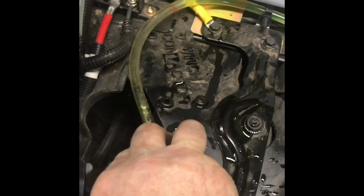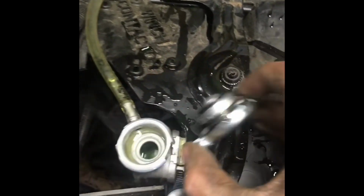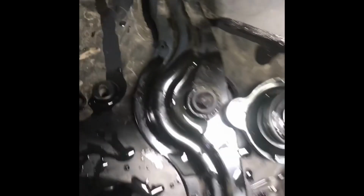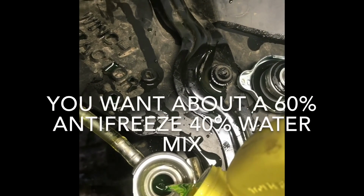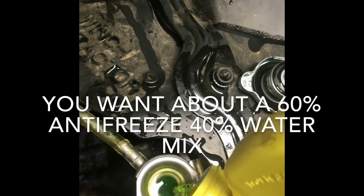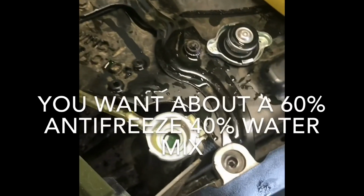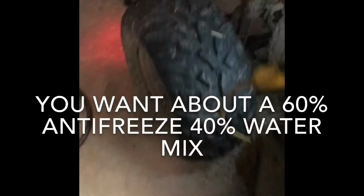The pressure should be off of this. I'm going to go slow just in case there's a little bit more there than I think there is. Yep. Okay, so now see that dropped way down, so we better get on it here. This is hard to do looking through the camera. Remember that valve is open, so we're pouring coolant out on the manifold a little bit, not much, but that's going to force that air out of there.